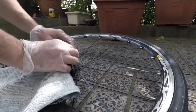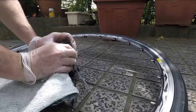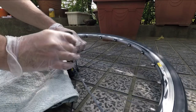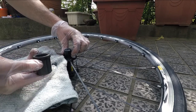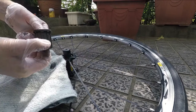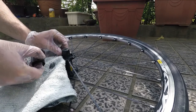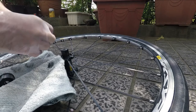Now what we're going to do here is take off the freehub. Be careful — when you're pulling it off, there are these spring-loaded things called pawls, P-A-W-L-S. I'm holding them with my left hand here. Now I'm going to look inside — yeah, it's been a long time. It needs to be re-oiled. Use a light mineral oil, not a grease. Those little pawl things I was talking about — mine has two of them. They just pull off. Be careful, they're spring-loaded. There are little springs in them.